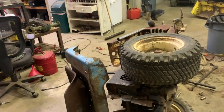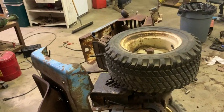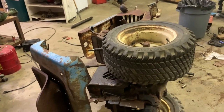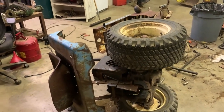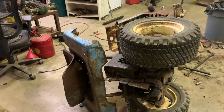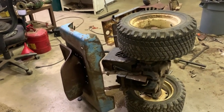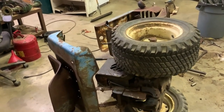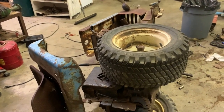There's a swash plate up there, and there's also a pump for running if you have hydraulic lift or power steering or anything else. There is a hydraulic pump up above that pumps fluid. That pump is the one that is constantly going. And then there's a section of the pump down below that drives the wheels. They even use them in skid steers and excavators. You could use them even in combines.